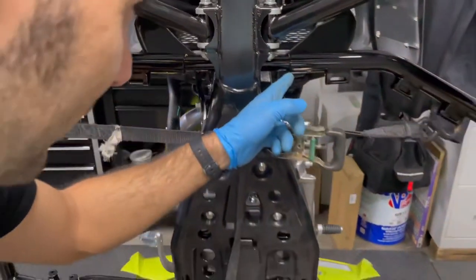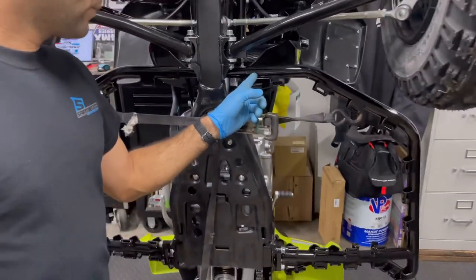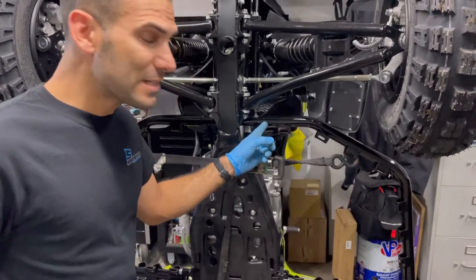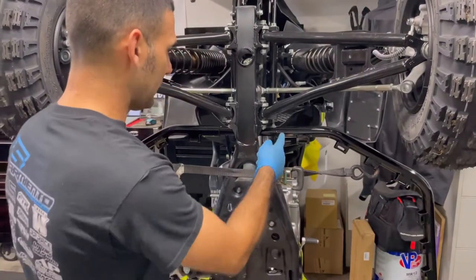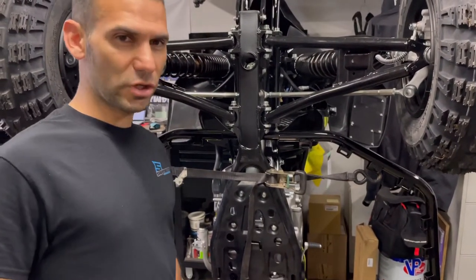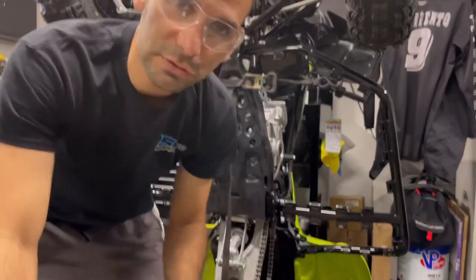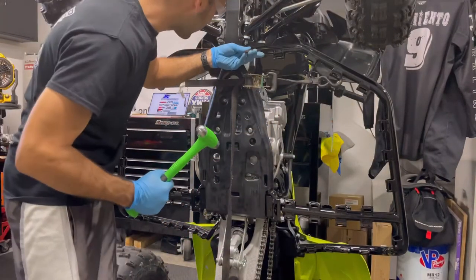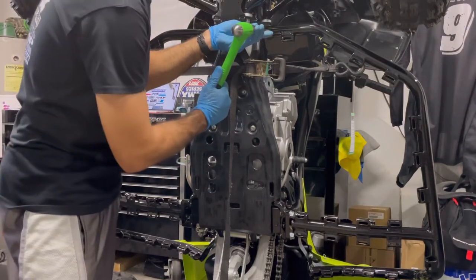They did add bolt holes for those that don't mind drilling. It's actually an easy time to do that now especially when it's lifted up - you're not on your hands and knees. Safety glasses because we're drilling. Get yourself a nice little center punch, doesn't have to be a gigantic hammer, whatever hammer you have could be a claw hammer. Just a little tap underneath. This is optional, you do not have to do this.